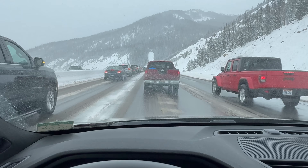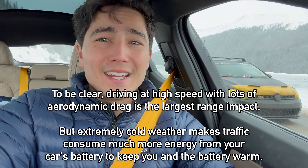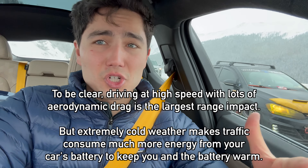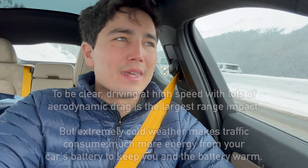I have to get into the topic of efficiency differences in traffic in an electric car in the cold. Normally you're more efficient going slower in traffic because you're not driving the motors as hard. However, in the cold you kind of want to keep driving to generate heat. When stuck in significant traffic for 20 to 30 minutes, that can actually ruin your efficiency because you're not going anywhere and still have to keep the cabin and battery heated. So my efficiency is going to drop a bit. The worst case would be stopping to make a bunch of errands — your car would have to reheat itself from the battery each time without preconditioning available.